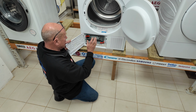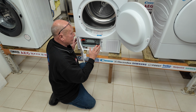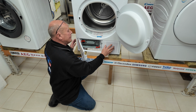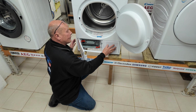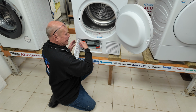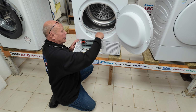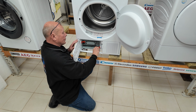The condenser is down here, but you need to understand the two airflows that take place. Cold air is drawn into the machine through a separate fan blade at the front of the machine. This cold air goes across the condenser and out to the bottom of the machine. The warm air travels through the ducting unit and then through the condenser.